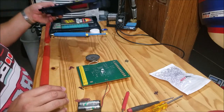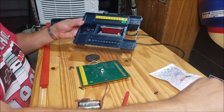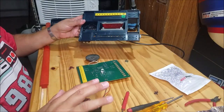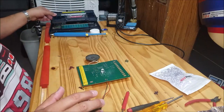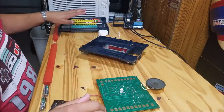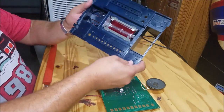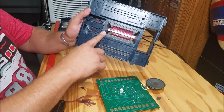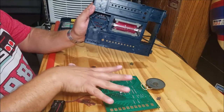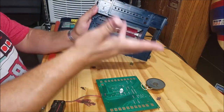What I'm going to do next is clean up all these pads and the buttons as well. I'm going to cut up this tape and line the inside with reflective tape, and then we'll get everything ready to start putting back together. I'll go ahead and fast forward to that. So I've gone ahead and cleaned up all of these pads — you can see some of the filth there on my Q-tip. And I've also gone ahead and used that reflective tape right here inside of the chamber. You can see it on the side and the strip around the top, so that when that LED goes off, not only is it already going to be super bright and much brighter than the original, but it's also going to reflect off those surfaces and just light up that entire chamber.